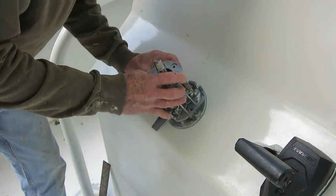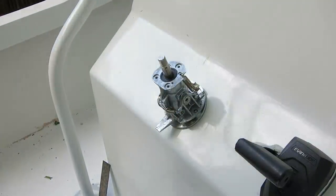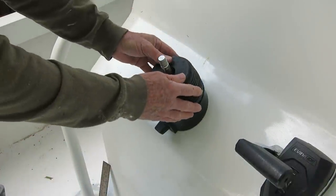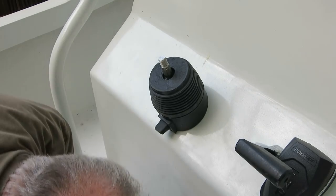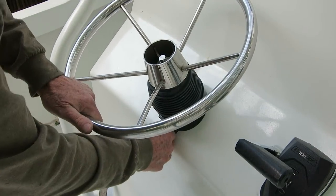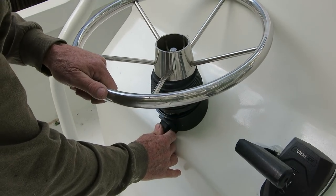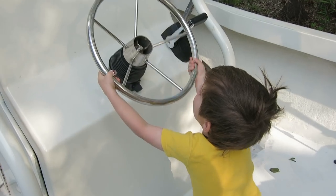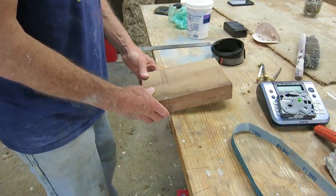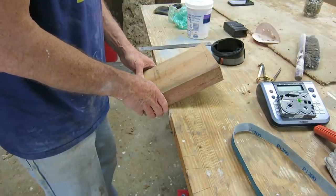The tilt mechanism slides right on with two screws. I dropped on a plastic trim piece and a rubber boot, but I'm not fastening either one yet because I still want to buff the paint. It tilts up and it tilts down — can't tilt all the way up because it hits. Final quality control: I'm going to raise the steering wheel a little and tilt it more so it doesn't hit the upper part of the console — someone could actually break it.